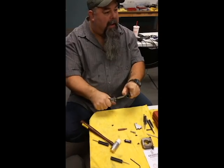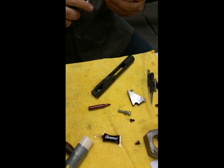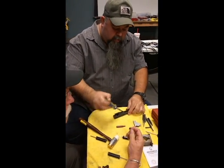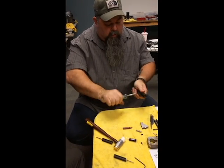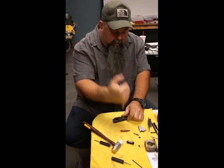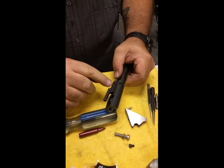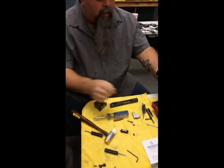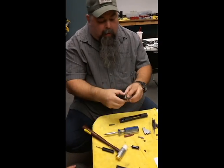Look at the difference - it's the new one on the right with the thicker wall. You can see how easily the old one bypassed the staking. Look at how much of the head of that screw engages the sidewall of the carrier key - the other one was more sunk down and there was not as much engagement there. This is where you torque it down - imaginary inch-pound torque wrench, click click click. Now you can barely tell where that thing was staked because the original staking was so poor.